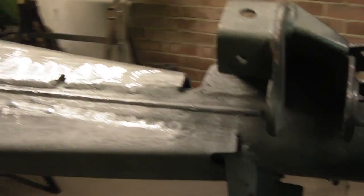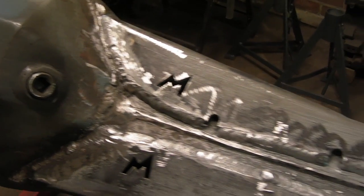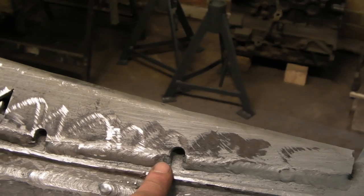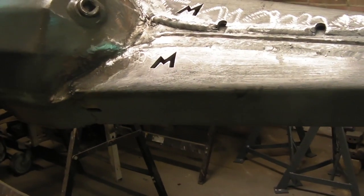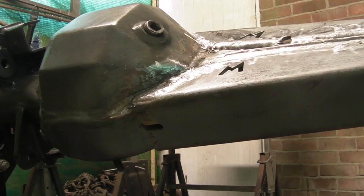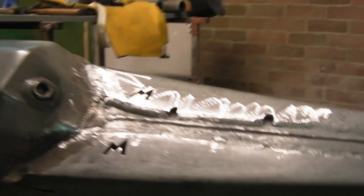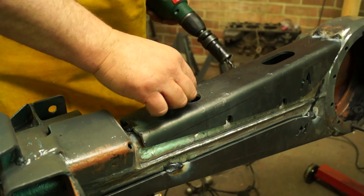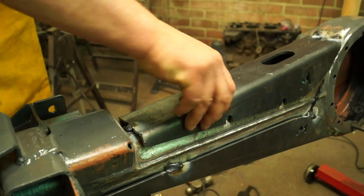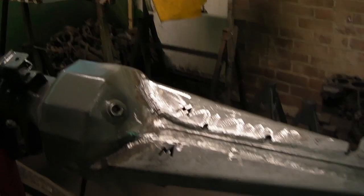So there you have it — that's welded up, the same on both sides. These are drain holes and they need to be kept clear, so don't weld them up. There have been comments on Facebook about drain holes for water and mud — underneath there is a drain hole so if it's clear it should let fluids out, and the end is not welded so there's clear passage. If you're unsure you can always drill some holes with a tank cutter, just remember not to drill into the axle casing itself or you'll have leaks.